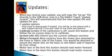You can also calibrate your machine if, when you are doing something and you touch, say, the home or one of your icons, it's not exactly where you touched it that you're getting. You can calibrate the screen, and using your stylus will help with that so that you don't have to recalibrate your screen a lot. Keep in mind, when you touch things, static things like that, little shift screens, even on your sewing machine and things like that. That's why a lot of the machines come with a stylus so that you can have a better working relationship with that screen.